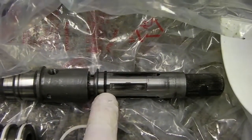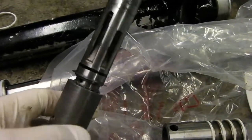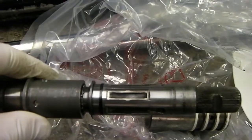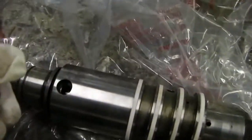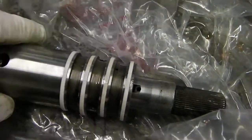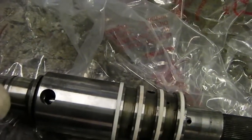I've also replaced the seal on the shaft, so now it's just a case of putting the shaft back. I should also mention I replaced the bronze bush inside here so that the shaft is now firmer again — that was a case of fitting the bush and then turning it out gently on the lathe until it was a nice close fit. Now we have to fit the aligning screw back into the valve — it's offset at the top — and the idea is you screw it in, move it around until these line up clearly in the centre of the splines, then fit it with a touch of Loctite.